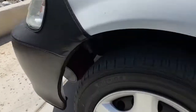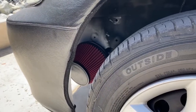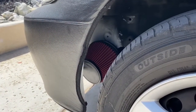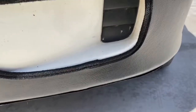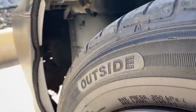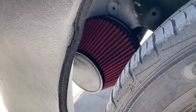What I'm gonna do to the civic today — you guys see how the hybrid intake sits right there? It's designed to be a colder intake and it does come with a velocity stack. What I'd like to do, just to make it a little more efficient, is elbow it right there with a 90 so it'll face straight. Then I'm gonna cut the fog light hole right there, so once I cut the hole and put the 90 elbow, it's gonna be facing right there — wide open — so the velocity stack will go into effect versus just having the filter like that.